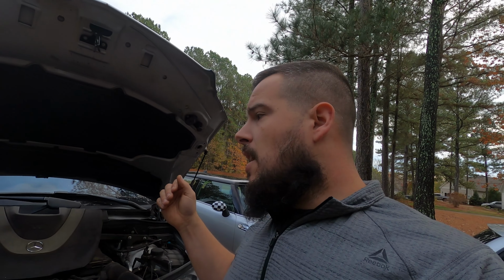Hopefully this helps you guys diagnose some simple stuff when a belt is coming apart on your car, having a part issue where it starts to come apart like that. Like I said, it's going to be one of two things. It's either going to be fluid leaking on the belt or a misaligned pulley. In a future video I will show everyone how to check for a misaligned pulley. It usually requires some special tools in order to do that. I have access to them, so I'll show you guys how that works.